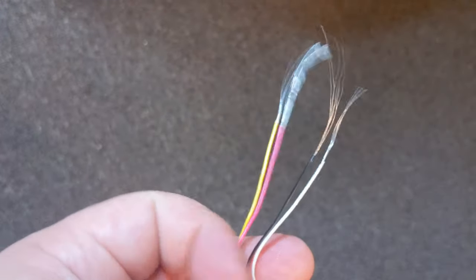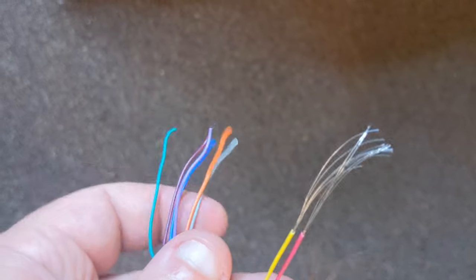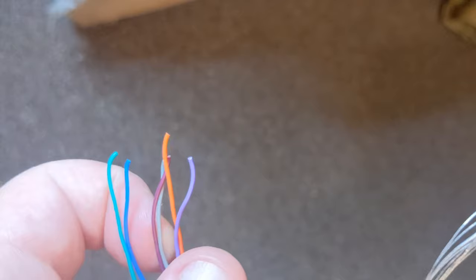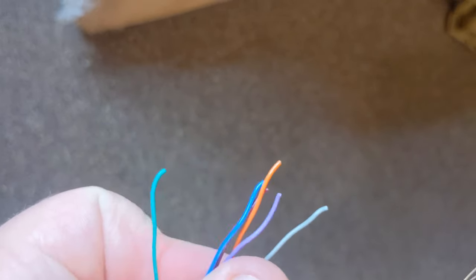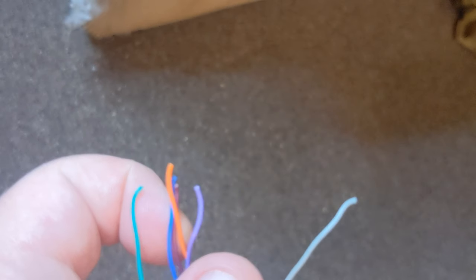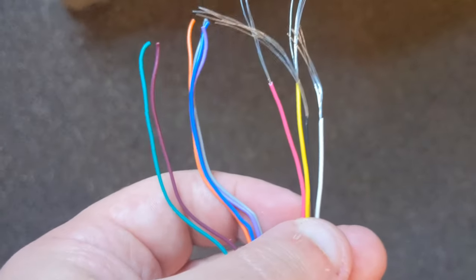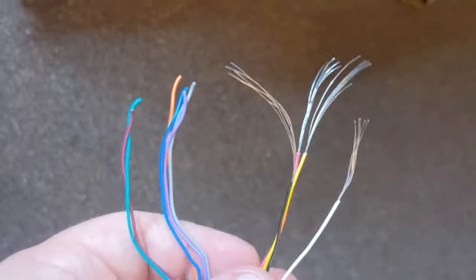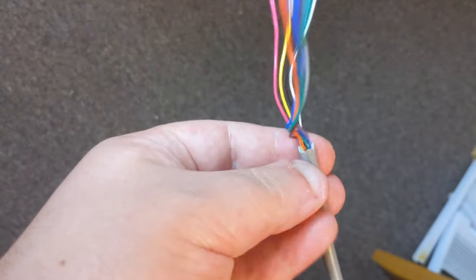There are 10 wires that control that front board. We are only going to use 4 of them. The last 6 we will leave untouched. The colors we are not using are orange, blue, green, purple, gray, and maroon. The colors we are using are white, black, yellow, and pink. The pink wire may appear to be red as well.